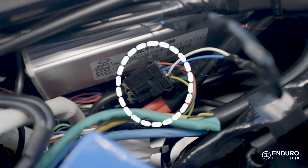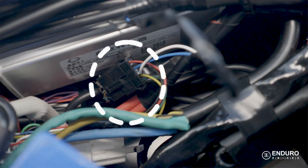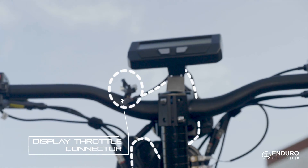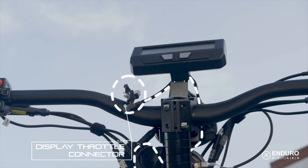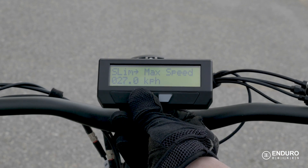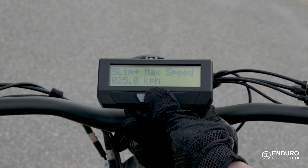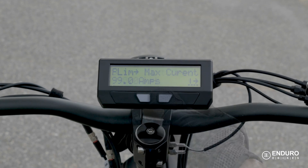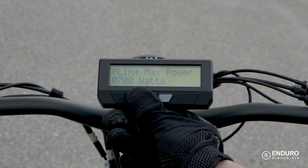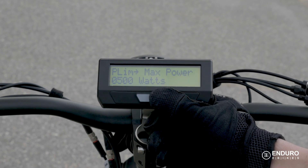Then finally, you've got this wire here that connects the display to your bike's controller or shunt. If you do decide to link the throttle to the display, you can set up speed limits and power limits using the Cycle Analyst display. You can access the options through the display's menus. Here, you can set up a maximum assist speed, a minimum speed for power to work, and even a maximum speed that applies only when the rider is using throttle with no pedaling.